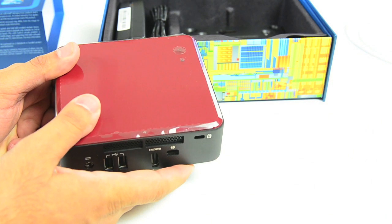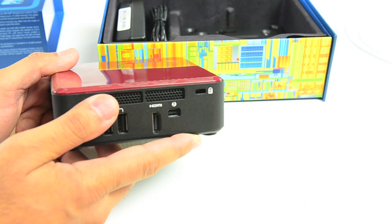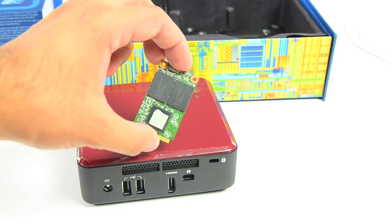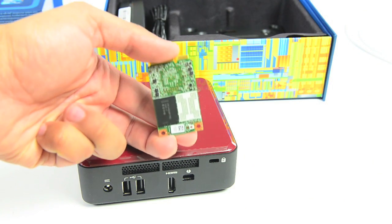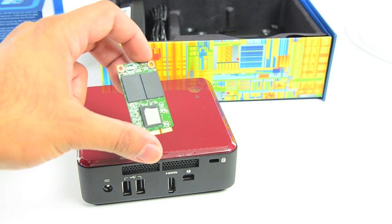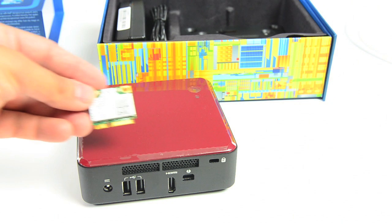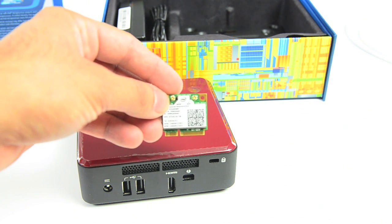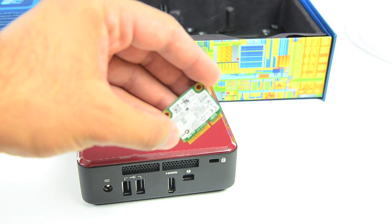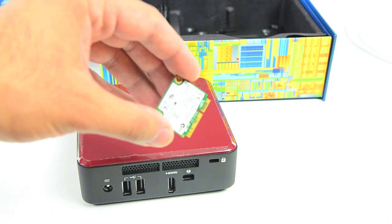This will ship for about $399 without any storage or Wi-Fi. It will come with the processor — it's a Core i3 in here. So Intel sent along the mSATA version of Intel's SSD 520. This is a SandForce-based mSATA SSD. SandForce is particularly useful in small form factors because they don't require an external DRAM. I've also got the Centrino Wireless 6235, a dual-antenna 802.11n solution from Intel, and it will fit into a half-height mini PCI-E slot, which we'll find inside in a second.